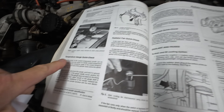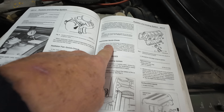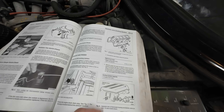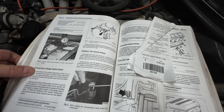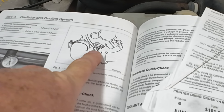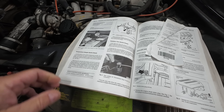We are going to check the temperature gauge — quick check, which is this right here. We're going to do a radiator fan check, which is this right here. And we're going to do the thermostat change, which is on into the next page. First part is really, really easy. We're going to do a temperature check. This right here is the temperature sender. It's below the distributor on the front of the engine. We attach it to ground, give it some power, and if the needle on the dash does something, then we know what is good and what is bad.